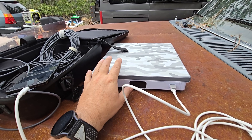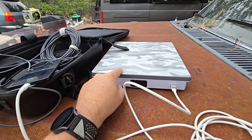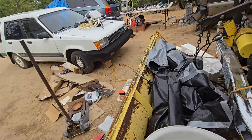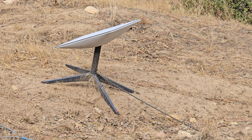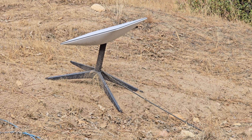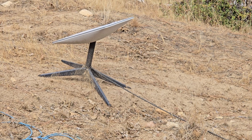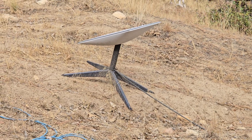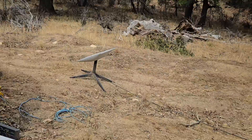That's the plan I have this set to right now. I don't have any plans to use a lot of bandwidth at my office for a little while, so I'll leave it at the $5 a month plan to save a little money — because I am paying for the Starlink residential plan. That is my 'alien on a stick' standard V2 articulated system, the second generation Starlink system. I've converted that over to 12 volt, so it has less power consumption. I also did the router delete and bypass, which basically means I use my own router, so I have better features and more control — I can do quality of service on certain devices and certain applications.